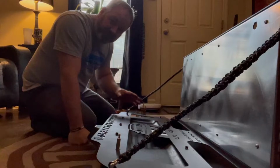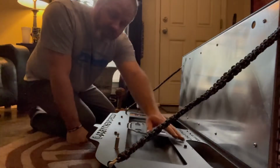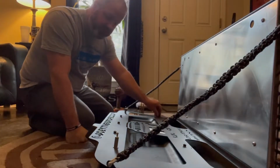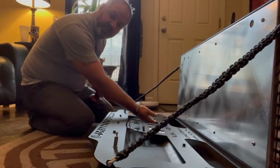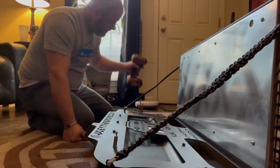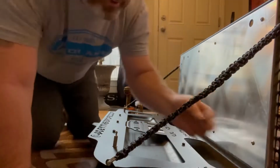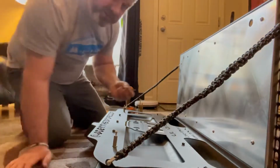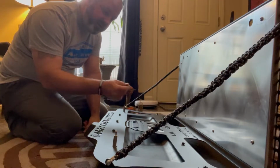So most of the bolts lined up perfect. Center, top, couple of the ones in the center. So really all I had to do was take a drill bit, take the spacer, put it in there, and hollow it out just a little bit. They send you these fender washers, so there's a lot of coverage on the other side. So it's real easy, if they don't line up just right, for you to get your spacer under there and get your nut on there pretty easy.